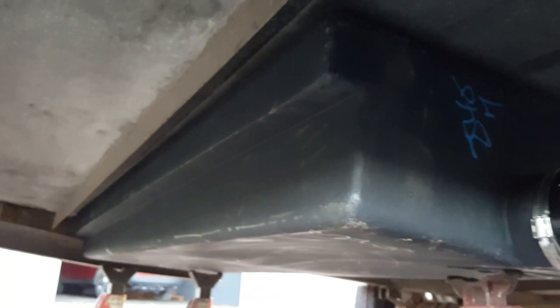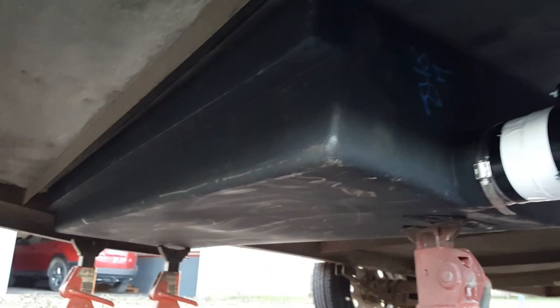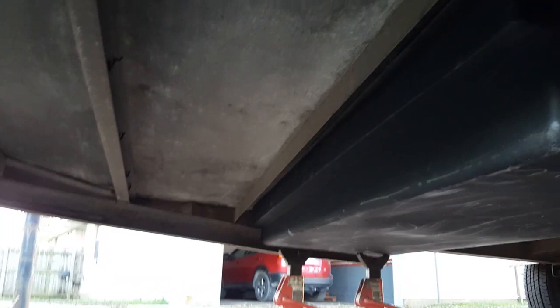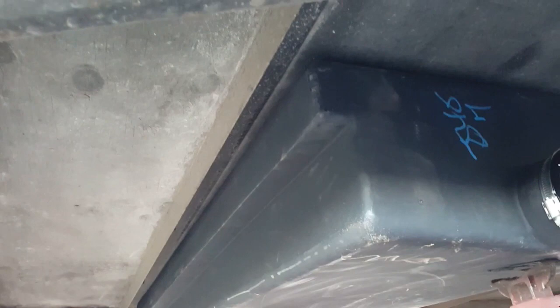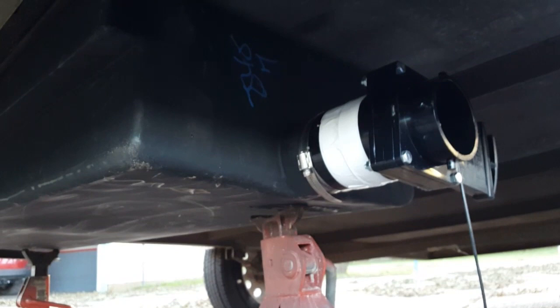Finally got it warm enough to lay underneath the trailer and try to mount the black tank on the bottom of the trailer. If I would have really planned this, I would have done the black tank first and then done the electric and all the other construction later — the plumbing probably should be the first thing. What I've got here is a 33-gallon black water tank, or gray water tank either one, and I'm trying to figure out where to put it. I need it as close to the front of the trailer, where the v-nose is, as I can get. It's not wide enough and it's too wide to fit here, unless I put it at the bottom of the channel — that would be two or three inches below the floor. I really wanted it up against the floor because it hangs down from the floor eight inches, and all this valve stuff is going to get knocked off if it hangs too low, so I really wanted it tucked up as tight as I could but still accessible.